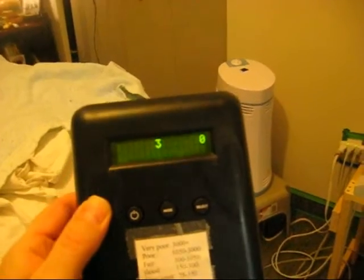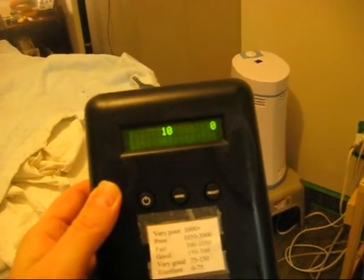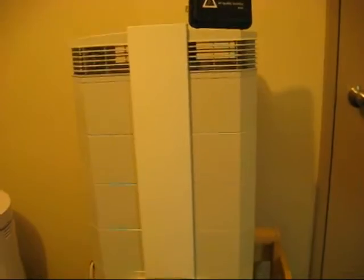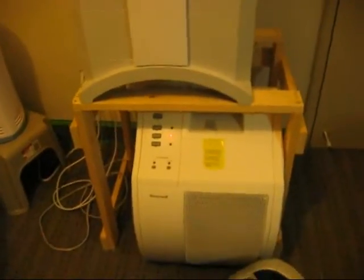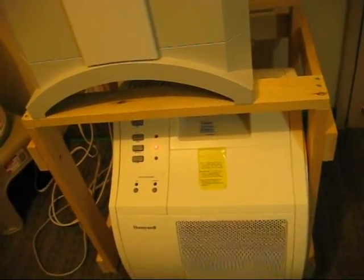If I did a test with this particle counter on an air cleaner fan that was putting out ultrafines, it would show zero and I would think the air cleaner is doing a good job — meanwhile it's putting out ultrafines that the counter isn't reading, and actually polluting your air. But the IQ Air I don't think does that. Quite an amazing machine — definitely go for it if you can afford it. And if you're wondering why I'm double filtering here, I've made another video on my channel explaining that. Basically I'm filtering the air going into the IQ Air just to preserve the filters and make them last a long time, because they're very, very pricey.